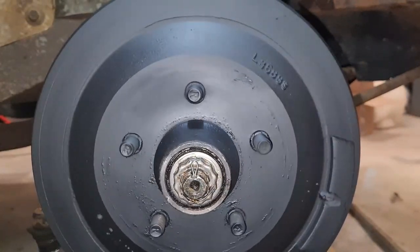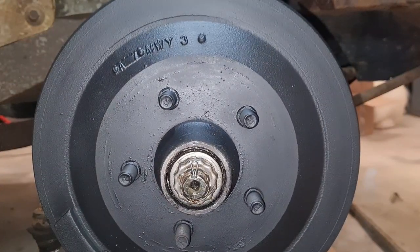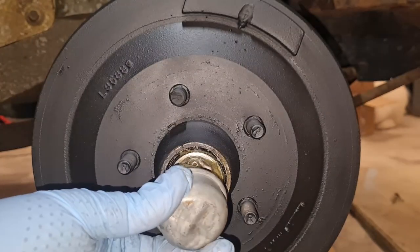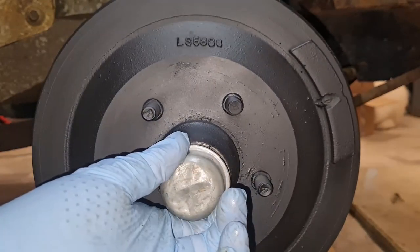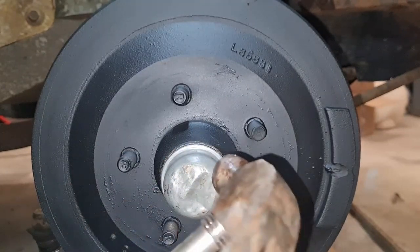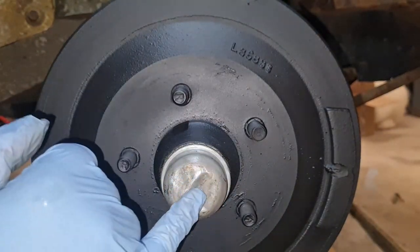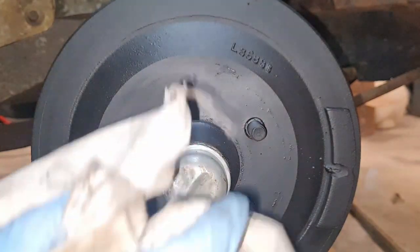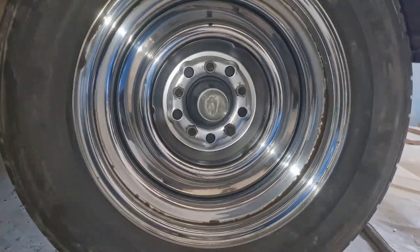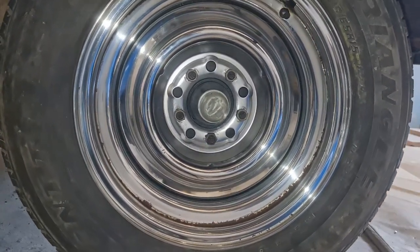Just like that — coming to a lovely stop. Now put your cap on — clean it out, put some grease in it, that should be enough — then just place it over and give it a gentle tap around with your hammer. I don't know why people absolutely beat the hell out of these and dent them — you don't need to hit them hard. And that is that. With the wheel on, give it a nice gentle touch and she'll keep rolling and come to a beautiful stop. Sorted George — bearing adjusted lovely.